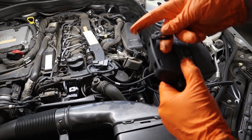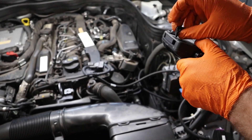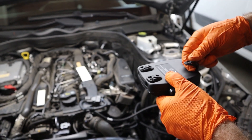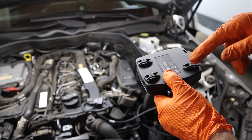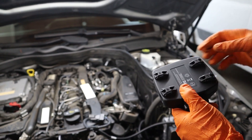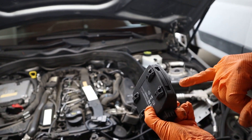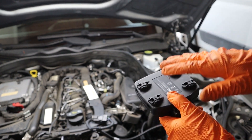Now that we have our wiring harness connections securely made, the next step is to mount the race chip using the four supplied mounting tabs. These tabs allow you to mount the race chip with the longer supplied zip ties either vertically or horizontally. If you ever need to remove the race chip for warranty or service work, you can press down on the four corners of the locking tabs and remove the race chip without cutting the zip ties.